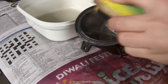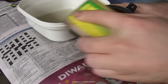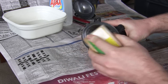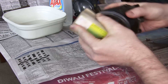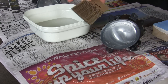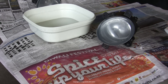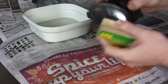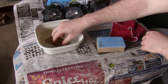I'm sanding in two dimensions at 90 degrees from each other. If you sand in a swirl pattern it can be harder to hide any of the remaining scratches later on. Also, if you want to sand horizontally, or at least the majority of stages horizontally when doing this on the car, it gives the paint a better surface to grip onto when it's sprayed, so it's less inclined to slide off and develop runs. Now once you're done with the coarser grit, switch up to the next finest and repeat. Each stage you're working on removing the scratches of the former stage, because if you have too many deep scratches from the coarser stages left over at the end, then the paint won't fill them and you'll be left with a poor finish.